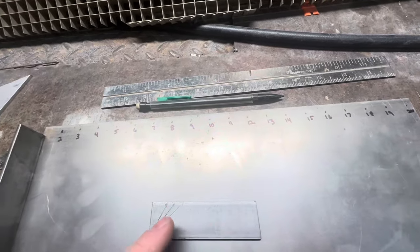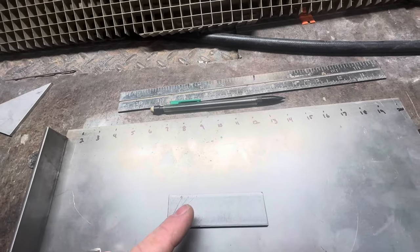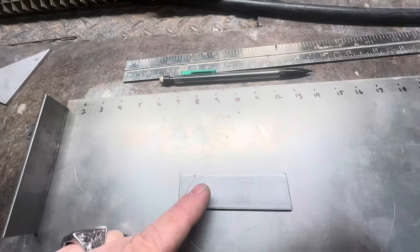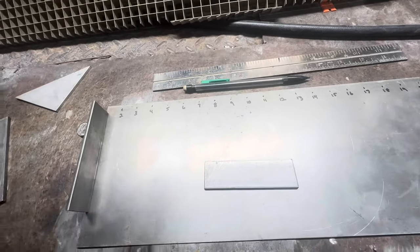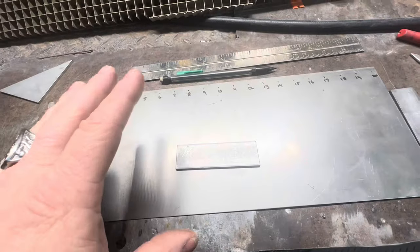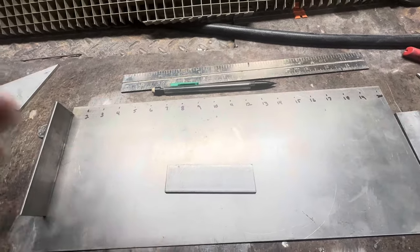Actually, it's more than that. But we went an eighth further past half. So that would be 5/8. So 5/8 down, and that gives us between a 22 and a 45, more like a 32-33 degree angle. But I like the 32-33 degree angle, so we're going to cut this on that angle and use this as